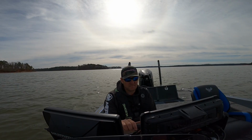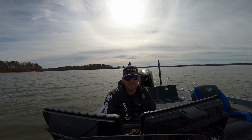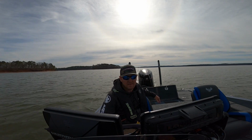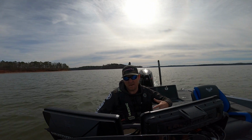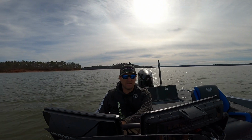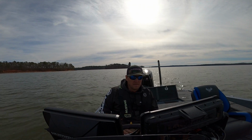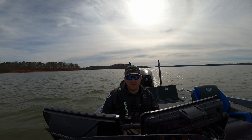I'm just going to mention, as I'm breaking in the motor, letting it run, getting a couple hours of break-in time on it, I like to go through the boat and check things. Right now I'm running the live well pumps, pump in, recirculate, air, oxygenators in there. I like to check all those and make sure they're operating right. And then like I said earlier, adjust my graphs, set them up how I run them in a tournament. So that's just some of the things you can do while you're breaking in a new motor. If you get a new boat, check all the pumps, all the switches, and make sure everything's running correctly.